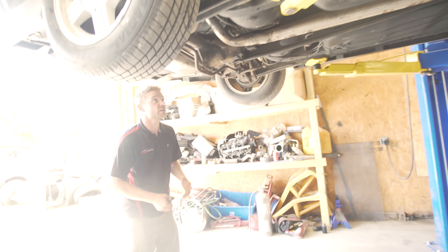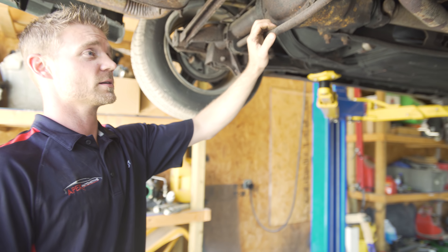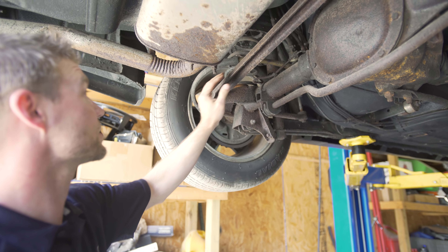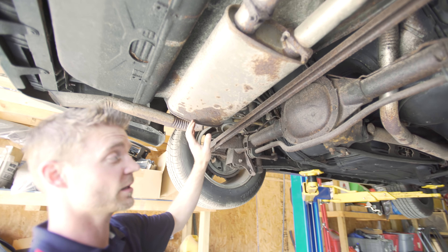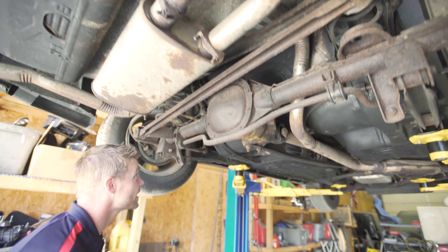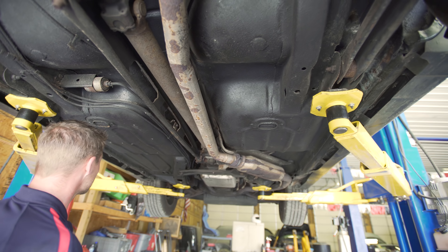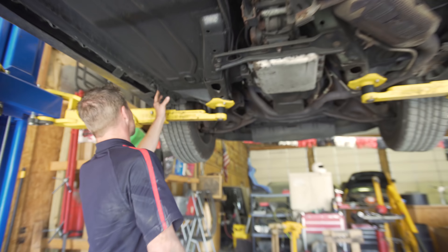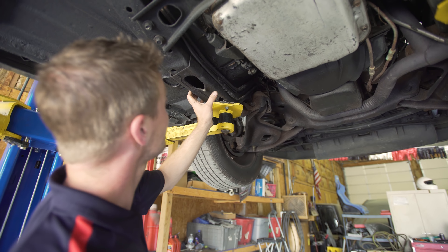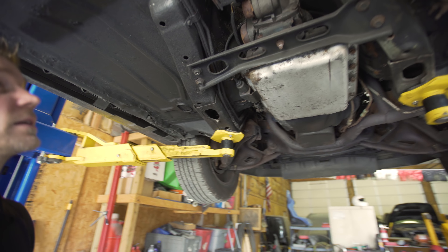Now we get to see what was hiding from us — the underside of the vehicle. Being a '92, we're gonna expect to see a little bit of rust; it's inevitable. Everything that's on here is surface rust, nothing rusted through. There's excess rust on the exhaust, but knowing the guy, he's probably gonna go with something that sounds pretty mean, so that's all going away anyway. Looks like it's had some underbody protection, which kept everything I was worried about intact. I was worried about holes being rusted through the floorboards — nothing. The unibody and frame looks like it's in good shape.